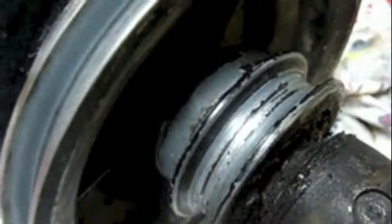I can't believe the giant hunks of crud that are falling out. I just took a screwdriver to scrape some of it out, but they're falling out from behind that pulley, because when that pulley was over, it was basically hiding all that stuff in there, so it never got washed when I had this in the parts cleaner. So this is still not working, and I can see where that's probably all gummed up and causing part of the problem as to why this doesn't shift easily.